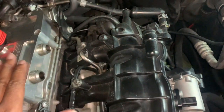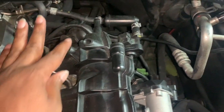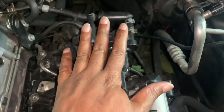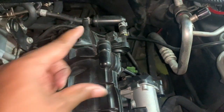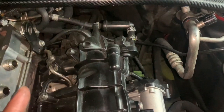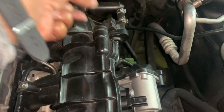If you don't have a catch can, you'll have a traditional PCV valve with a tube coming over to the air intake. What you want to do is generally pull out that tube to release it so the intake manifold is standalone. I'll show you a picture of what I'm talking about — you just want to gently pull this off. Be careful so it doesn't break; you can pinch it and pull it out.